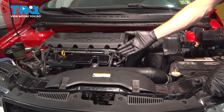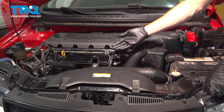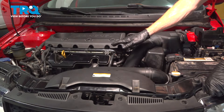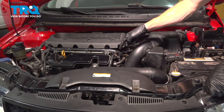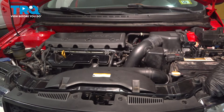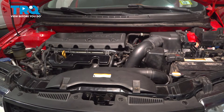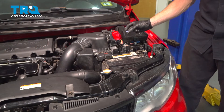The next thing we need to do is attempt to start the engine. What you're going to find is as you're cranking over the vehicle, it may start and then die out, or it may just keep cranking and not start at all. Either way, that means we have no fuel pressure making its way up inside the fuel rail, and at that point we can continue. We'll leave our fuse dislodged and continue on inside the rear of the passenger compartment.